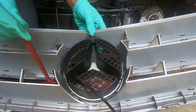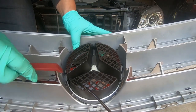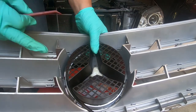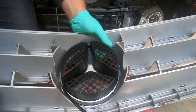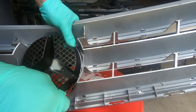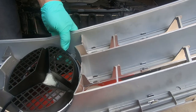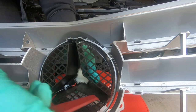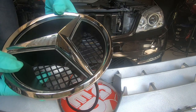You're trying to separate the grille from the logo so that the two side clips can push out. Get a plastic trim removal tool so you don't damage it. Push it in to separate the grille from the logo, giving enough space for those clips to push through. Do the same on the other side — separate it and push it through. Once you have these two side clips removed, the logo will just slide straight out. The top two clips are much larger, so the sides are where you remove from and the top one will just slide out.